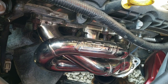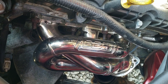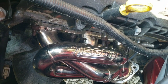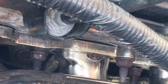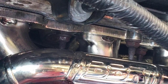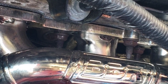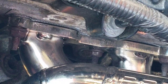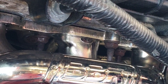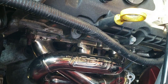All right, I'm gonna make it long story short here. So at this point in the video, I had discovered that my header flange where it bolts to the head was actually warped. And I went on talking about it for quite a while, which is making the video way too long. You see the gap there. So if you want to know about that, check out the video. I posted a video about the header issue. I'll put a link to that in the description here. It'll also be in the Mustang playlist if you want to know more about that. But in the end, I ended up double gasketing this because BBK never sent me my header.